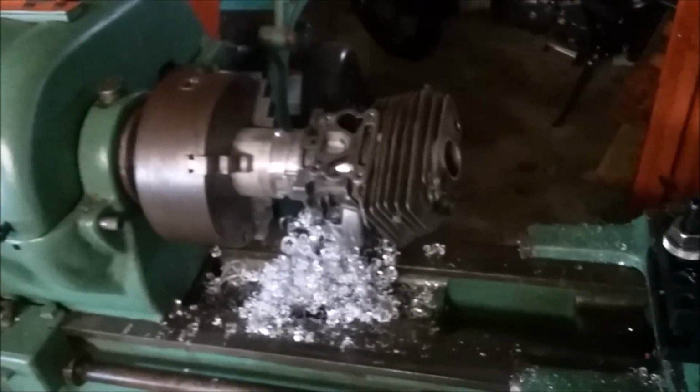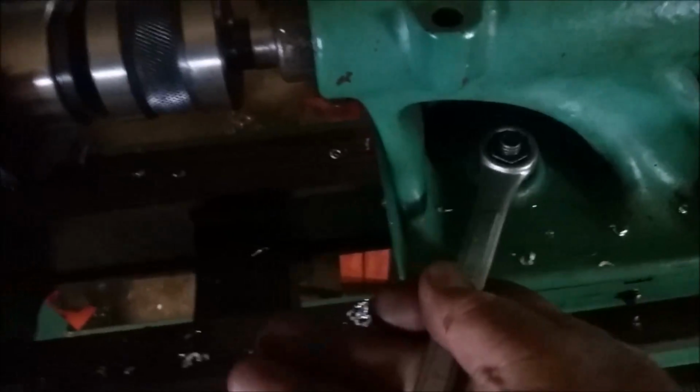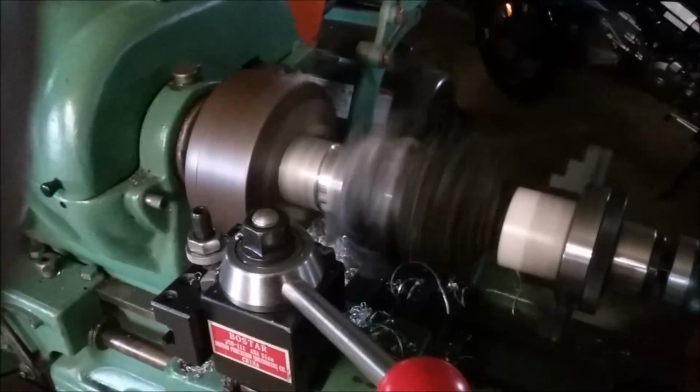Now what I'm going to do on the tailstock is get something I can push into the cylinder, and just with a little pressure it'll be enough traction, because the depth of cut I'm going to do on this is really, really small. So basically what I have here is I took a block of plastic, and actually it's Teflon, and then I'm just going to put it on my tailstock, cinch that up a little bit so it won't push back, and then I'm just going to give it a little bit of pressure. Not much, because I don't want to flex the cylinder relative to that arbor, and then just see what it does. And really all that is going to give a little bit of pressure on the inside of the cylinder so its bore sits tight onto that piece of aluminum that has enough traction to drive the cylinder when I do my cuts. And that's pretty safe.